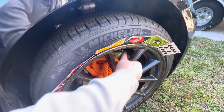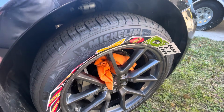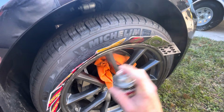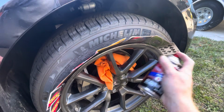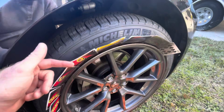Now, once that's done, I kind of sloppily just covered the rotor here, just to make sure no crazy overspray gets in on the first coat here. And I sprayed right at the top there, just back and forth, giving it just a light dusting to start. If you notice fish eyes with this spray can, then your surface is not clean. Repeat the previous step with the alcohol. I'm going to put 2 total coats on this, and that should give it a nice finish there.